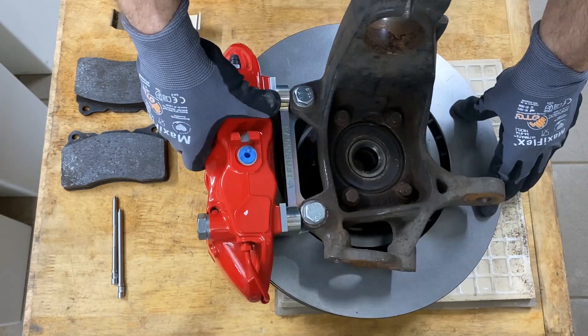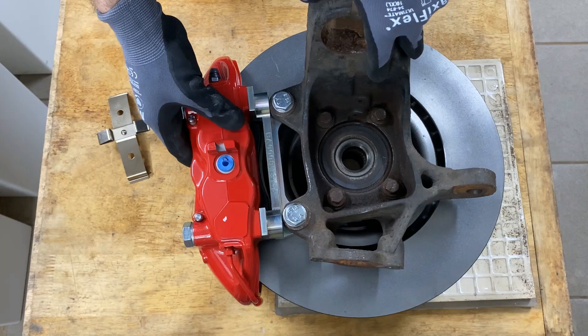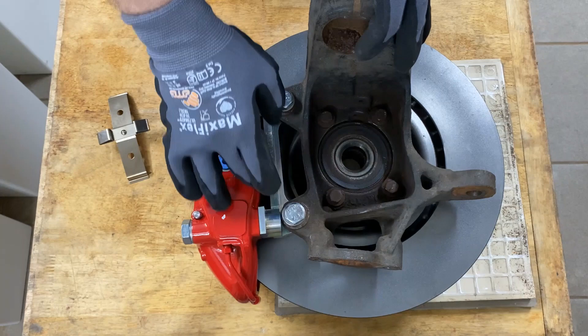It's time to install the brake pads. Usually the retainer spring goes underneath here but it's quite hard to install, so I will not do that — the purpose is only to show you how it gets installed. Here you can see the brake pad sits on the entire surface of the brake disc on both sides, so it's very efficient for that rotor size.